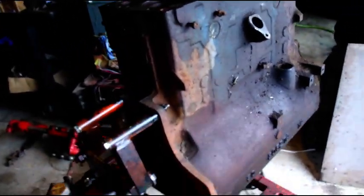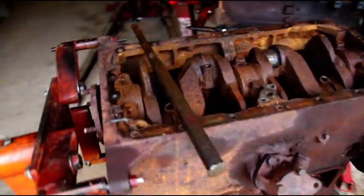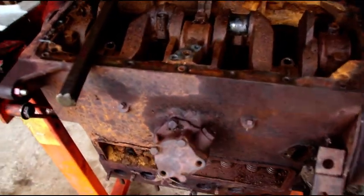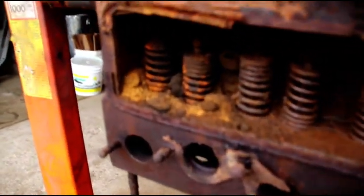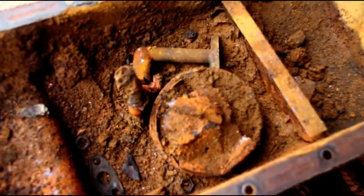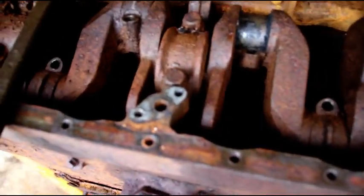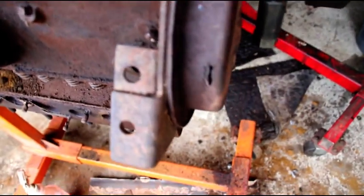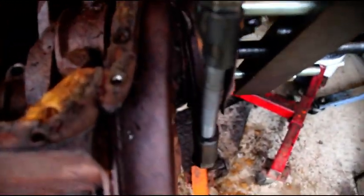The F-head is completely disassembled. This is a chain drive early CJ Two-A engine and you can see it's a disaster. Guys, you got to start checking the engines out before you send them. I'm not going to be able to save much — I'm hoping to be able to save the block. I will get you another crank. The cover is worn through; I can fix that. I'm having a hell of a time getting the pulley off.